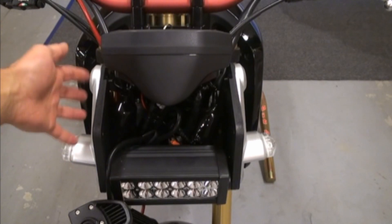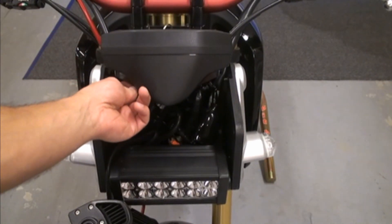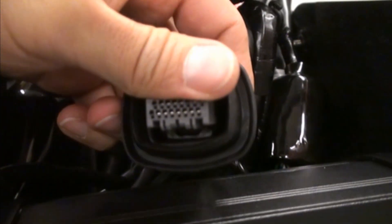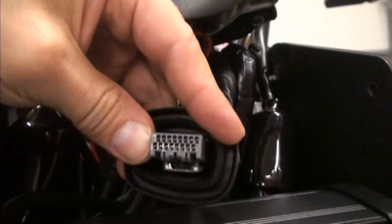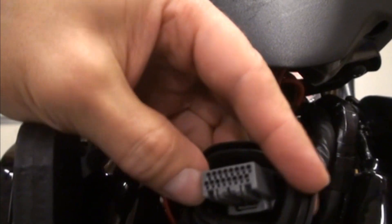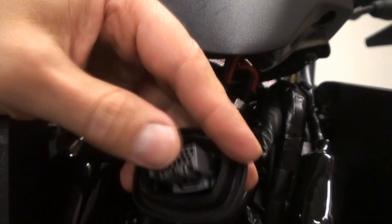It took about 15 seconds to unscrew both sides and drop the top headlight out of the way. If you have a stock headlight it'll take a little bit longer for the extra two bolts on each side, but you just get it out of the way so you can access underneath the OEM plug for your dash. Under here is where the harness comes in — there's a rubber boot that you want to peel back from the stock gauge. Once you get that peeled back, you press the little release button on the plug and it pops up. That's all you do.